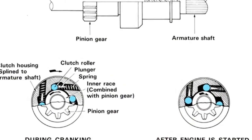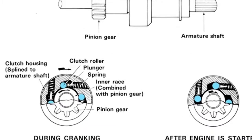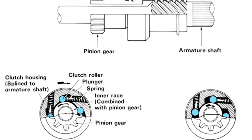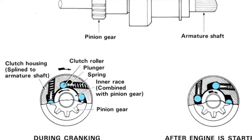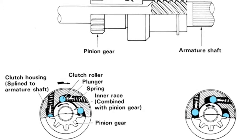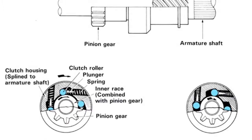This is a one-way clutch. After the engine is fired, the pinion speed will exceed the armature speed. If the motor is still in use, the inner race of the unidirectional clutch will exceed the armature speed and the rollers in the unidirectional clutch will then be unlocked, and the clutch will slip to protect the motor from being driven and the consequent risk of over-revving the armature.